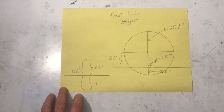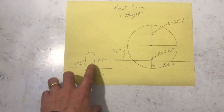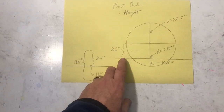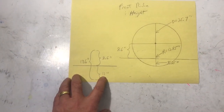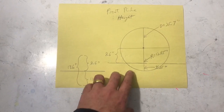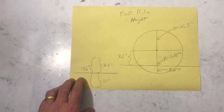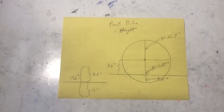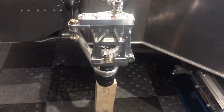Our car's chassis bottom is currently 11 inches off the ground. Adding the 8.6-inch offset to that gives 19.6 inches — so I need the center of the upright to be 19.6 inches off the ground. I'll set zero camber and zero toe at that height. This is all in theory, but hopefully the measurements are accurate and I only have to do this once.